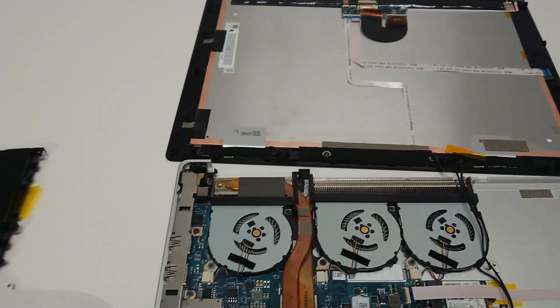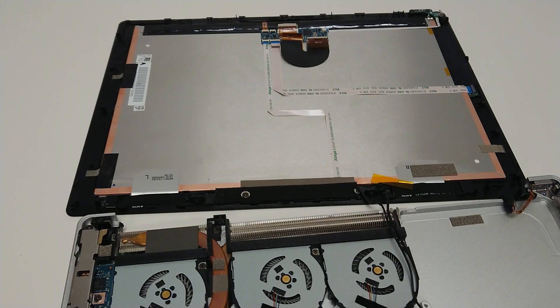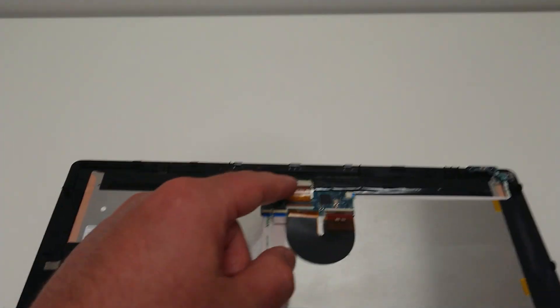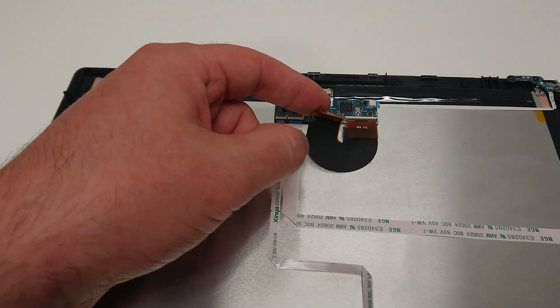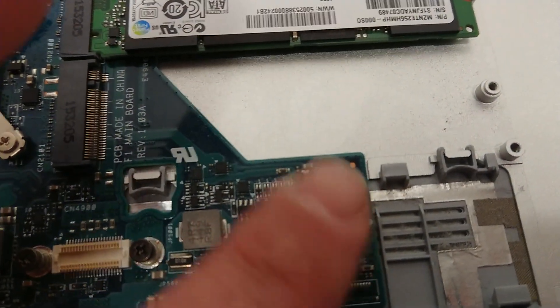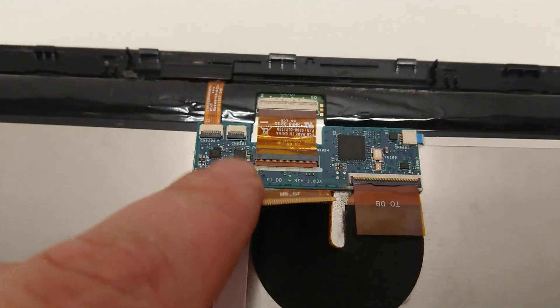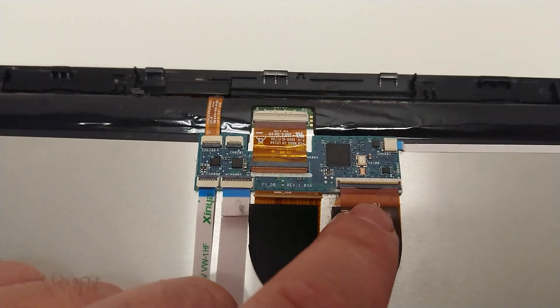My screen was already cracked due to the battery, but I definitely damaged it a little more while taking it apart, so just take your time. I don't think it's that difficult — you just have to go very slow. I've seen another disassembly video that talked about how this cable is very flimsy, but I'm actually surprised — it's really not that bad. It has a very standard clip where the little plastic opens and closes, and in fact it has one on each side of the video cable, so you can choose which one you want to pick off, making it fairly easy to remove.